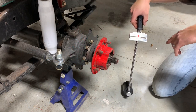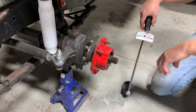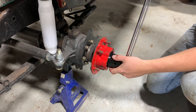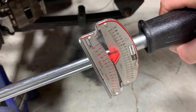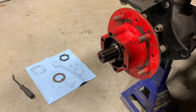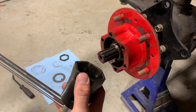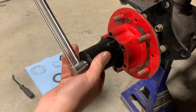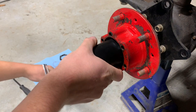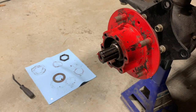This is where our torque wrench comes in, and also why it's really important to get this correct spindle nut socket. We're gonna torque this inner nut down to 50 foot-pounds. Now that we've got our first nut torqued down to 50 foot-pounds, we're actually gonna take our socket — and if you'll notice this is a six-sided socket — we're gonna rotate counterclockwise and loosen it one flat. We've got a flat right here and now we've got this flat on top. That puts the correct preload on your bearings. It feels nice — there's no slop, no movement. That's really good.